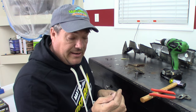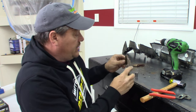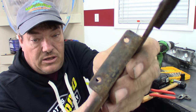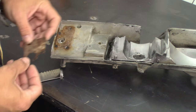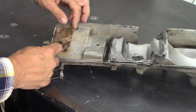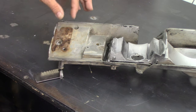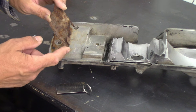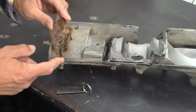I took my time getting these rivets out just so I could have something to reference as far as size goes, in case I decided to go back with rivets. This is the bracket we needed — it should clean up nice. That's a 5/32nd drill bit you'll need to drill those rivets out without getting into the metal. This right here is what's left of the part we need to make for our tail light housing. You can see the outline on the housing itself, it's just going to make a 90-degree bend. I've already checked the gauge and it's right at 18 gauge, so I'll cut a square of metal big enough for the patch, put a 90 in it, trace this, and cut out only what we need.